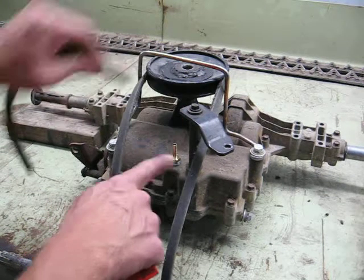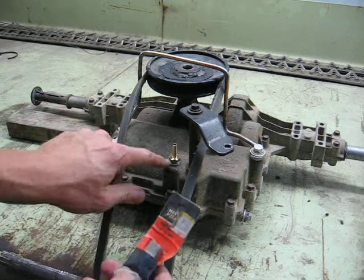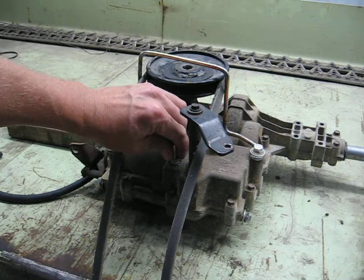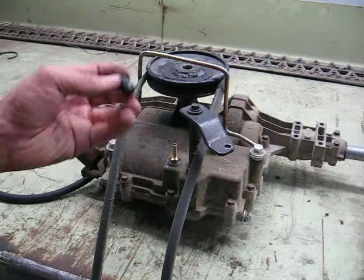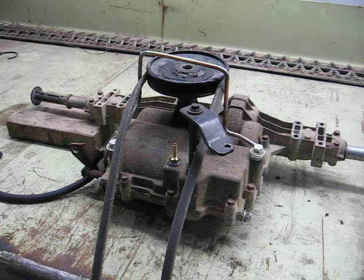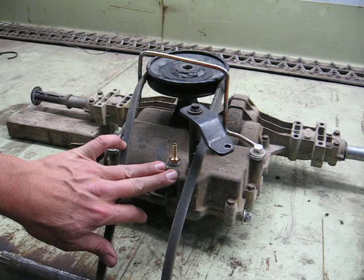This was a bit tricky — the hole in these Murrays is a little bigger than you really want. Here's my pipe tap, and it says right on there to use a 7/16th drill, but that hole is quite a bit bigger than 7/16ths. It's fairly close to being too large, but with a proper amount of thread tape and a light tightening with a small crescent wrench, I think it's going to hold fine considering it's only a vent tube. If it doesn't, I haven't ruined it — I can put the original plug back in, drill somewhere else, and relocate the fitting over in this area, since below the shifter is a good-sized cavity inside the rear end where there are no gears.